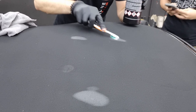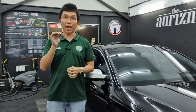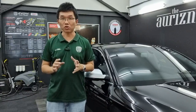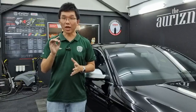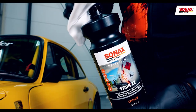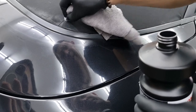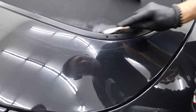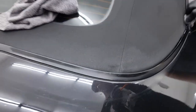So the first thing to do when we clean a convertible soft top is to individually target all the stubborn stains. You may need to use a solvent for this, and it is advised that you be extremely conservative with the quantity that you use — you want to remove the stains but you don't want to damage the fabric. The product we are using is the Sonax Profile Line Stain X, a hydrocarbon-based solvent. Notice we did not apply the solvent directly on the surface but rather damped it on a wet cloth and later on a toothbrush, and we gently scrub all the various stains until they come off.